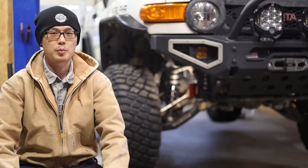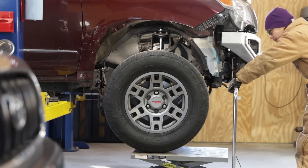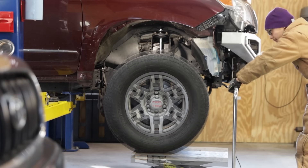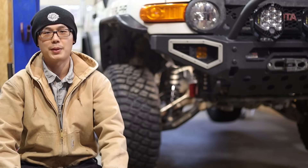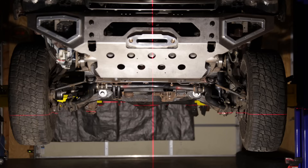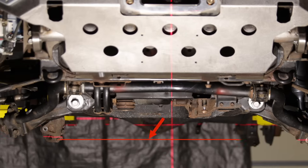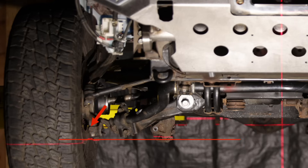We saw KDSS definitely improve articulation on stock vehicles, but what about with aftermarket suspensions? Extended travel is simply coilovers that are about half an inch longer, giving the wheel about 1 inch extra droop by motion ratio, with all other components at factory length. A common knowledge about KDSS is that the passenger wheel cannot achieve extended droop due to the fixed sway bar link — that is true, but only partially. With the extended travel shock installed on the driver side and the KDSS sway bar connected, the driver side achieves full droop, but the passenger side is limited to 1 inch higher. So in this scenario where both wheels droop together — usually in high-speed off-road — KDSS has a small limitation on the passenger side.